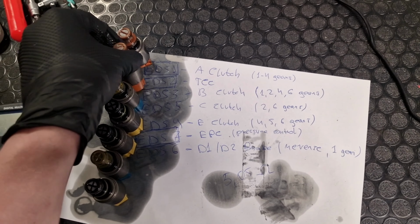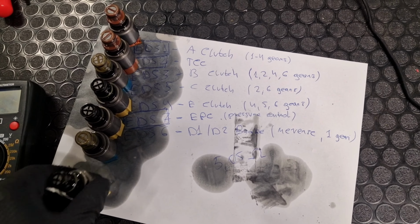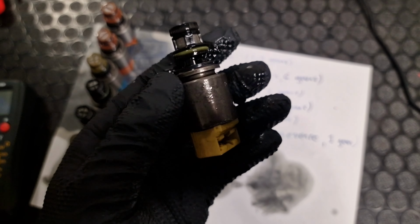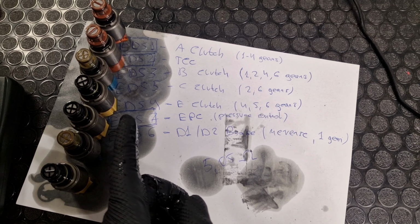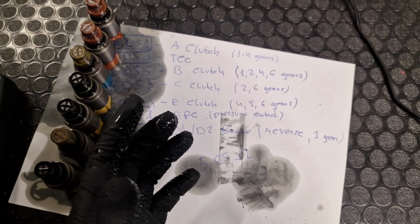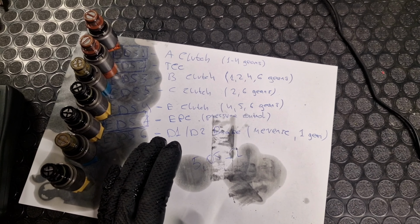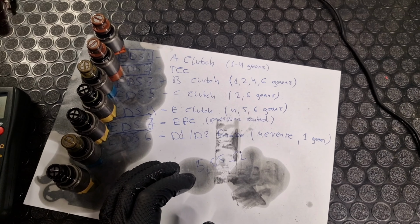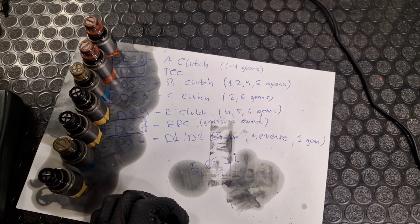So at least from an electrical perspective they're good, but actually they're pretty complicated inside. They can also lose pressure and a lot of other things, like they can get stuck in some position. I know that we can test them using some special tools from Sonnax, for instance, for pressure testing, but I don't have them, and I simply decided to replace them because there are many reviews on the internet that it helps, especially with some intermittent issues.